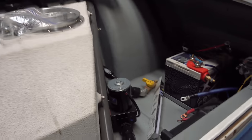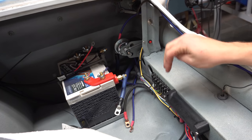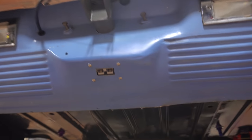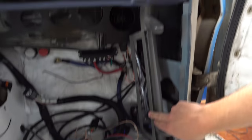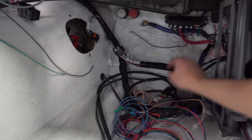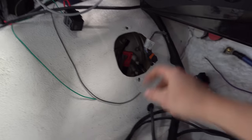The trunk is pretty much complete since the last video. Got all the wiring — these little MSD solid state relays are really cool — and those are the switches for the pumps and everything, so that's pretty much all done. Got the charge port for the 16-volt battery. In here is where all the Holley stuff is going to mount. If you haven't done an EFI car, that's where all the fun is — tons and tons of wire. This mount here is for the Dominator ECU. Got all our power, and all this stuff is going to have to be tied into the Dominator — transmission, little access panel so you can pull the carpet back, get to the trans, and check all the fluids.